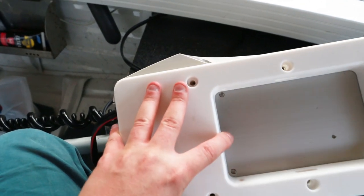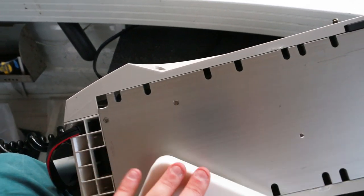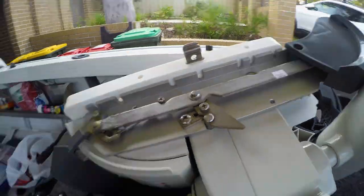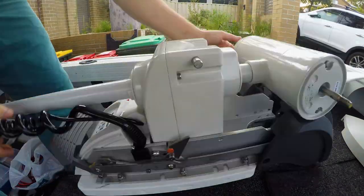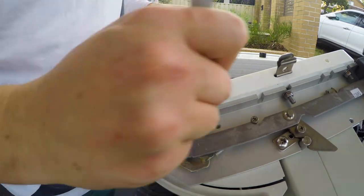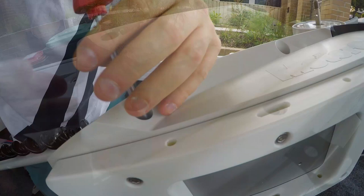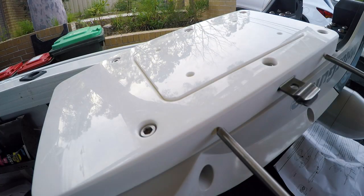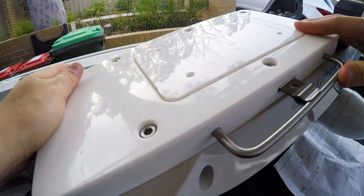Moving on, the quick-release plate needs to be connected to the motor for spontaneous fishing jaunts. The Delrin plate mounts directly to the aluminium base via six M6 bolts. This process requires a safe space to work, as the design of the bracket provides barely enough room to use the washers as they fall on the internal wall — be patient and try to wind on the washers; that'll make more sense when you actually have to do it. After you've emotionally recovered from that ordeal, you should probably check to see if you've installed the retaining clip onto the correct side.